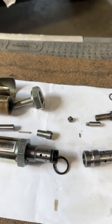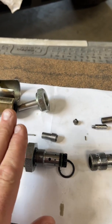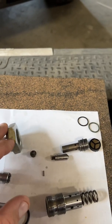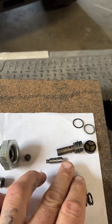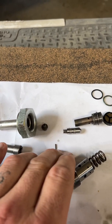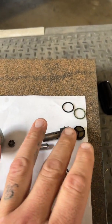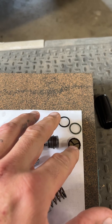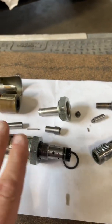To me it's more beneficial to spend around $200 — I paid about $30 for overnight FedEx Express shipping — to know it's brand new and not have to worry about it. I do believe it would be doable to pull it apart if there's some debris on this little needle. The screen could also be damaged — if your screen is damaged that's a good indication you've got debris in there. Really the only way debris gets in is from this end, so if your screen's intact you might just save yourself the headache and get a new one.